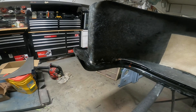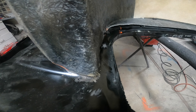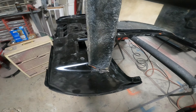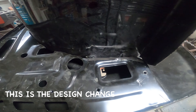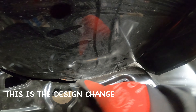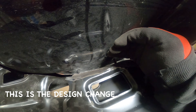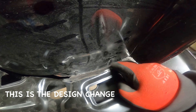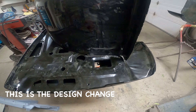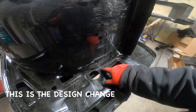On this side, we welded in the plate and the nuts, but the bolts are starting to go in at an angle. To correct that, on the back side coming into both of the welded nuts, I'm going to make a slice, fold this up to correct the angle of these two nuts, and then add another piece of metal in here. I'm trying to make sure I get all the tension off of the slosh tub and off of the fiberglass by making these corrections.